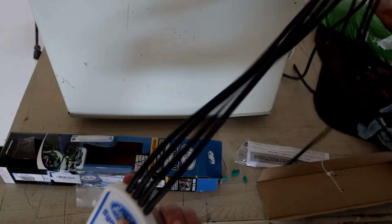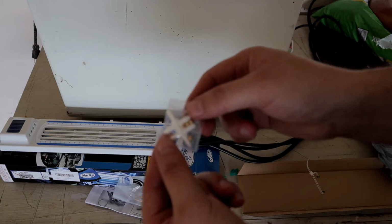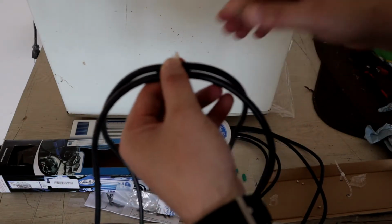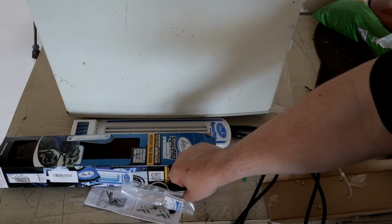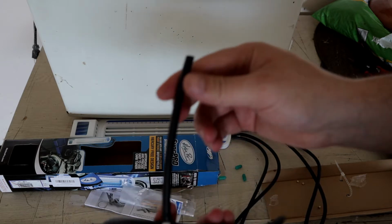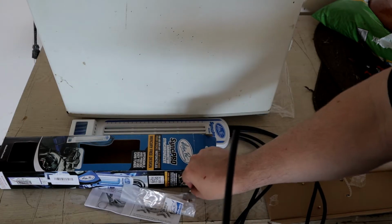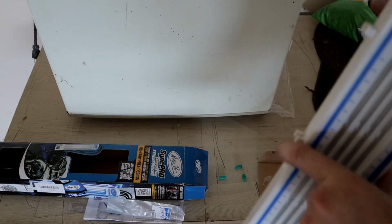All right, so now that you have these hoses attached, you're going to take the other end and you're going to put them in here. Okay. Then you're going to cap one off here to block it off. And then you're going to connect this little extra hose here, and then this end is going to go to one of your throttle bodies. This should go to your master throttle body or master carb, and then you're going to sync up the tool. So let's go into that.